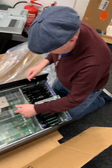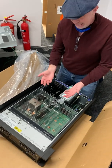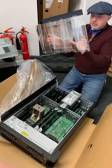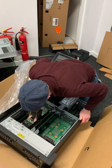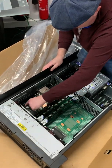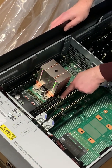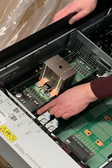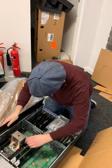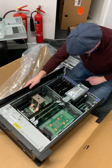I'm going to take a quick look forward. This is a single processor model, a 914 — it has one processor in it. That big piece of silver there isn't the processor, that's the heat sink: the thing that gets the heat out of it and cools it down. Everything's looking good there, it's nice and flat. The memory — I've got four DIMMs in here, surrounded by another 12 blanking plates. I'm not bothered about the blanking plates, but the ones that are memory — I just want to make sure they're all the way in. They've got little arms that grab into the side; make sure they're all the way up. That's in, that's in, that's in, that's in.